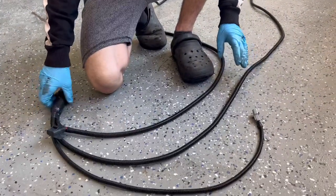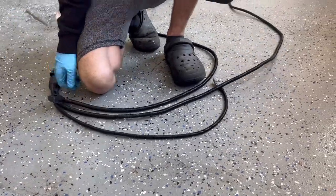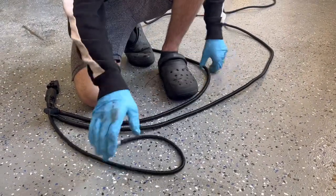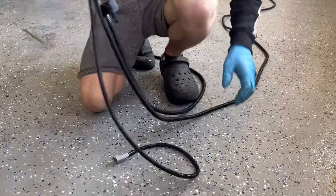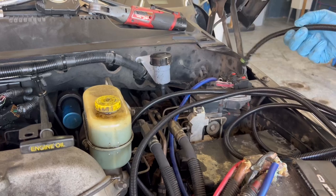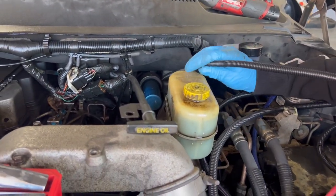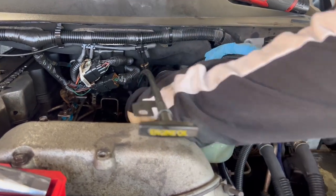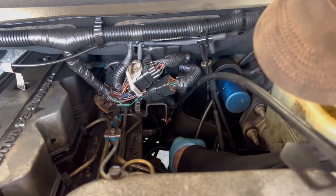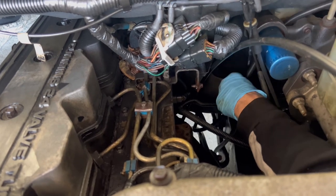So what we're going to start with is we're going to push this down through the fender, just like we did with the fuel line. Plug this in, loom all this back up, zip tie it up, and run this to our battery. Get all underneath the hood done first before anything, then we'll move to the back. What I like to do when I do my fuel systems is run the wires very neat — from my experience, I usually run them in between the booster and the throttle cable, and that'll give us enough play to run it very neat.